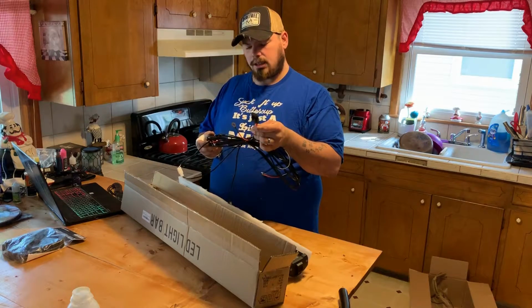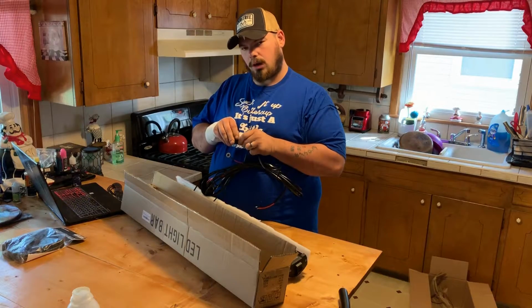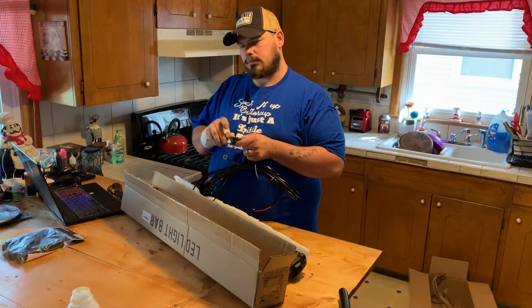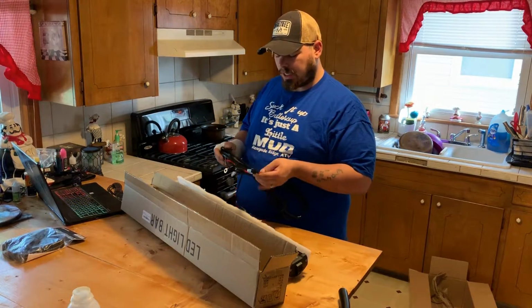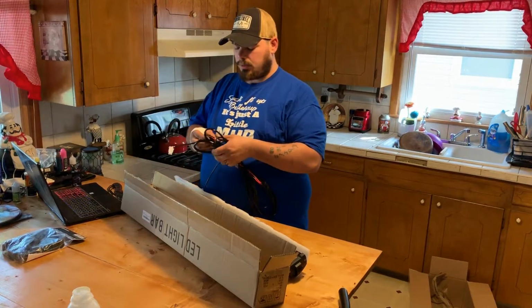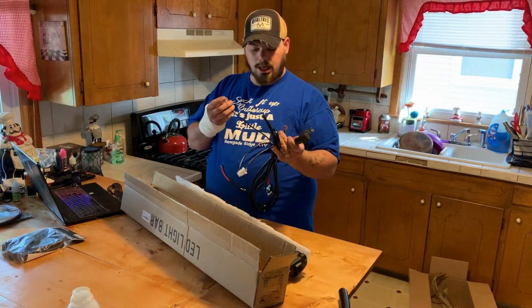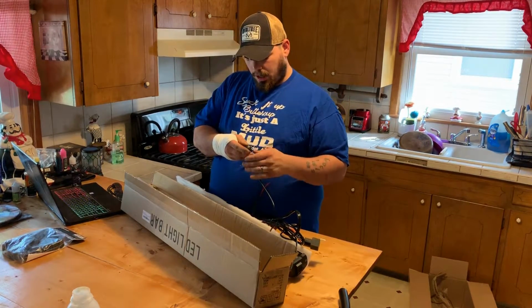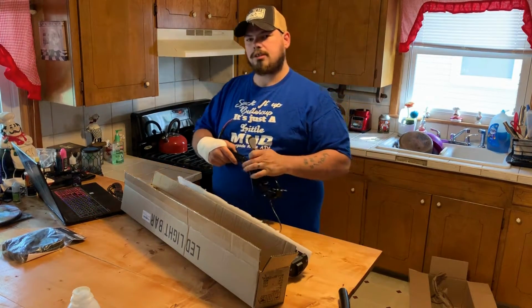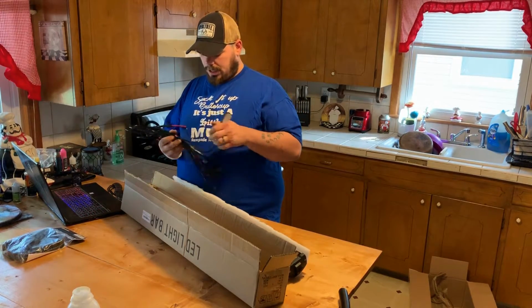I do not like that fuse link. We will be changing that out for a better waterproof design. Or we could just put some dielectric grease in there. Not that the link's bad, it just doesn't look very water resistant. We also will be putting dielectric grease in this relay. It comes with an on and off switch. We're cutting that off. I ordered switches for it. The switches that I ordered will be in the link in the description, so check that out also.